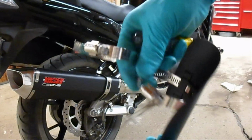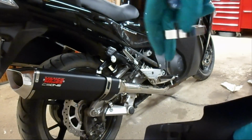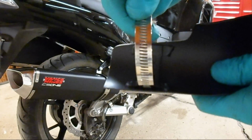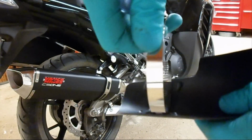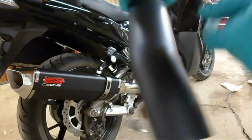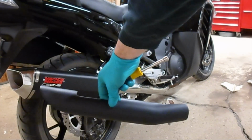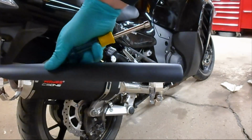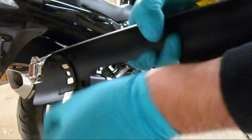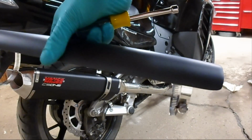Okay, to install the band clamps, you have to open them. They take a 5/16 nut driver or a standard screwdriver, either one. You need to insert them through here. And you have to insert them so that the screw is pointing down when you're done. Like this. That is the orientation of the pipe guard, and as you can see the hose clamps are pointed down. And now you just bend them open a little bit and slip it around the pipe and then tighten it so that these are hidden as much as possible.